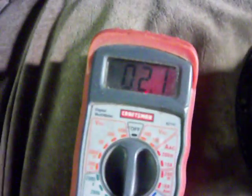Now this is all four speakers wired up and we're at 2 ohms. It actually should read 1 ohm, but it's reading 2.1 — probably because all of these are actually a little bit higher than 4 ohms to begin with. But you can obviously easily run four speakers on one channel of that amp and still not be beyond your restrictions. It's 0.5 ohm stable, so you've got a long way to go.